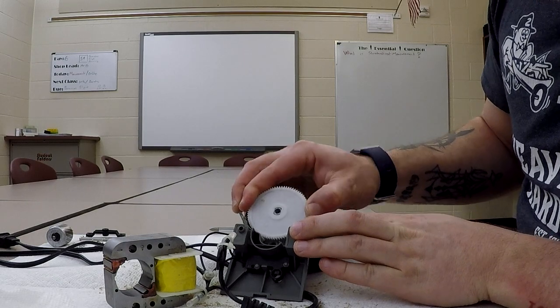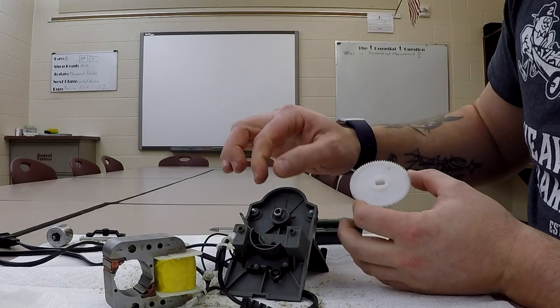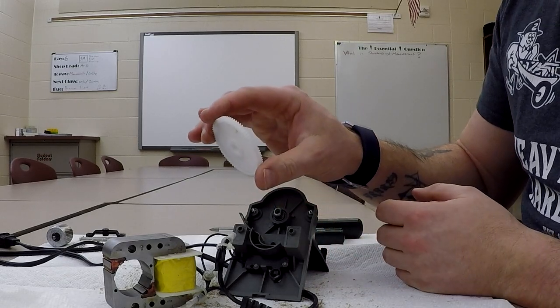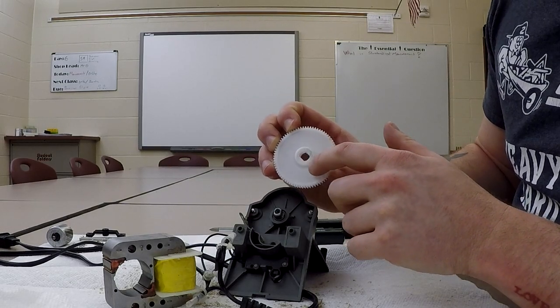And this uses a pretty standard type of drive. All right, so it's just slotted. Okay, so they've milled, originally would have milled two flats on the drive mechanism there, and then that's what gives it the positive drive. And there is a boss on the back for spacing. And again, you can see that it has some thrust right there. That's what that ring is from.